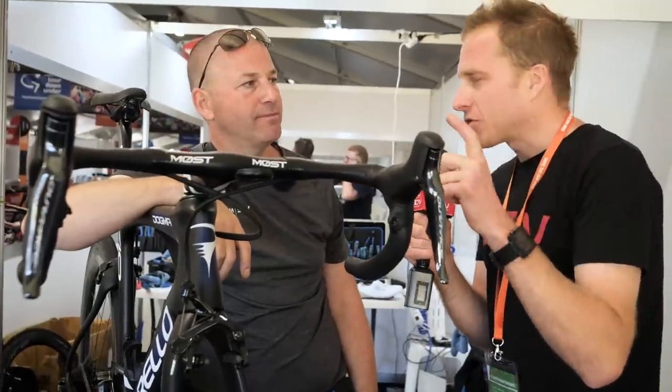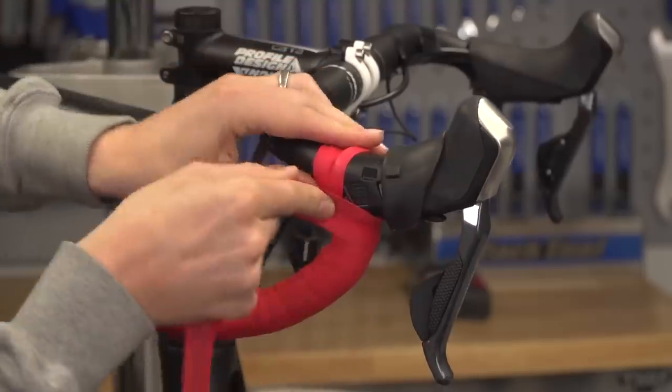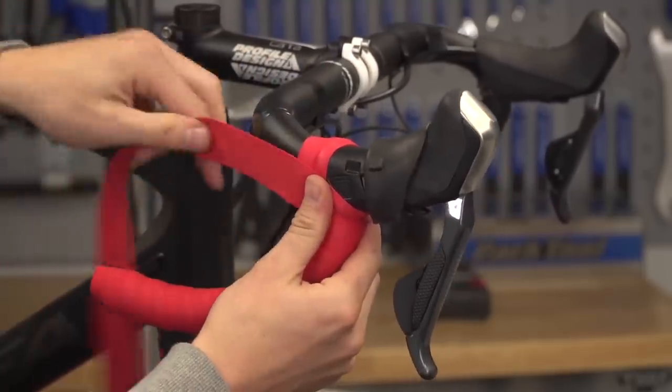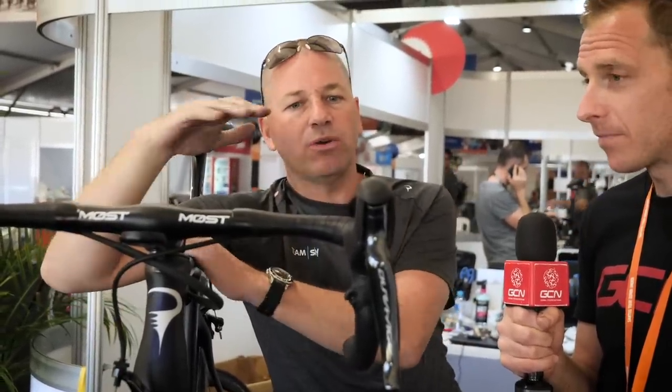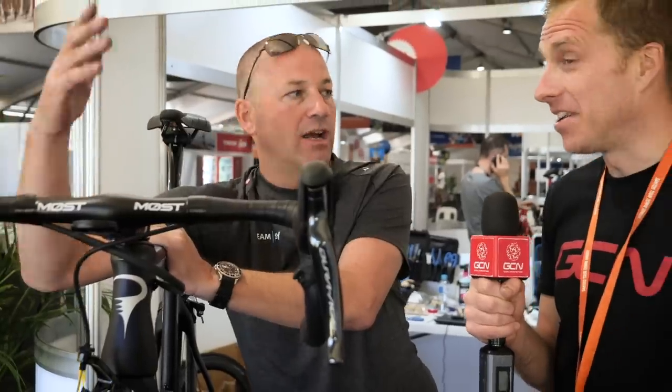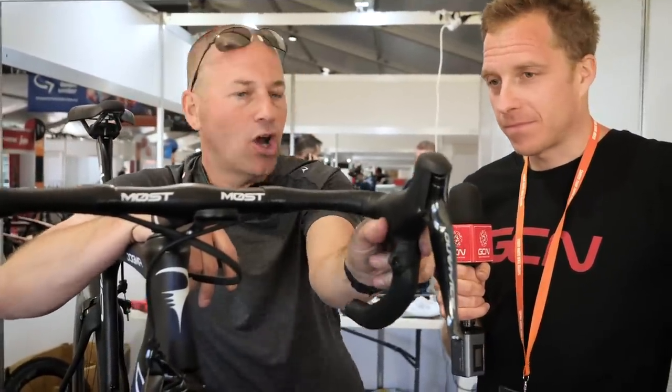What about the little extra strips of tape that come in the packet — do you ever use them? No. Just do the figure-eight. You pay attention to it, but no. Everything we do is based on it working as well as possible, but when you have 10 or 20 bikes to do, efficiency matters. If I can do a job five minutes faster and I've got 10 bikes to wrap, I'm done sooner. A smart figure-eight saves you all that cutting, holding, and fiddling around — we throw that stuff out.